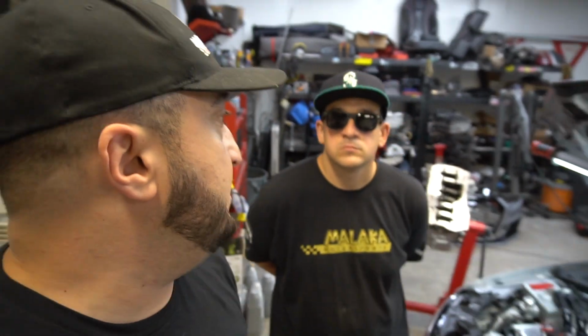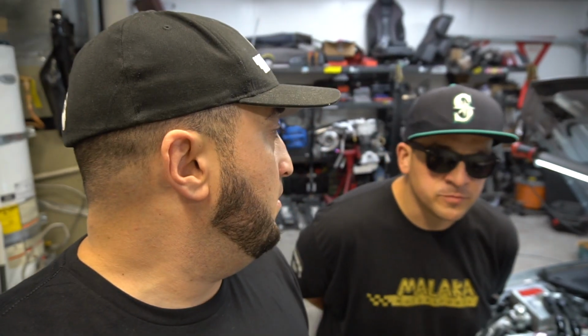People are actually using the surge tank technology in the newer cars. Why? Because it's proven, it works, it's simple. And for a 3-pump setup, I think with shipping and stuff, I was what, $1,100? $1,100 for a system that can support up to 1,600 horsepower. The pumps you ordered are 1,900 horsepower. Was it 19? Well, crank. I figured wheel. So let's say 1,800 crank, right?